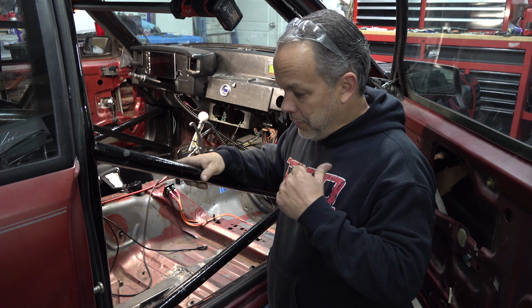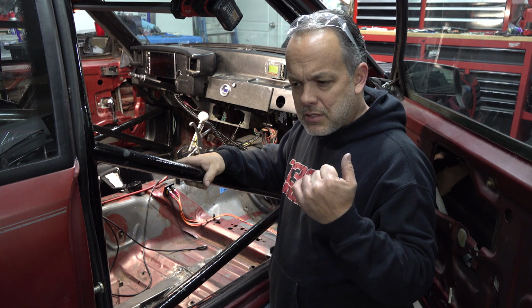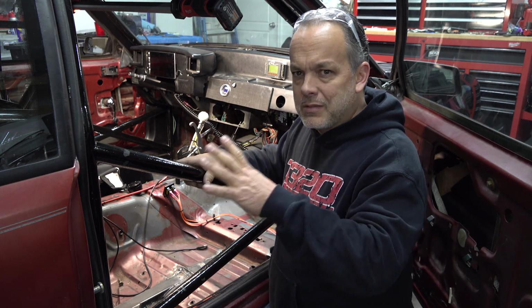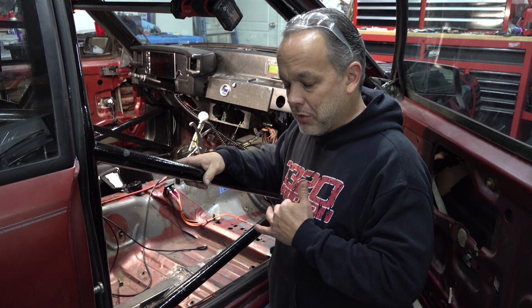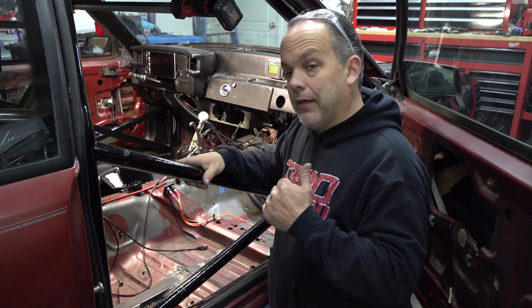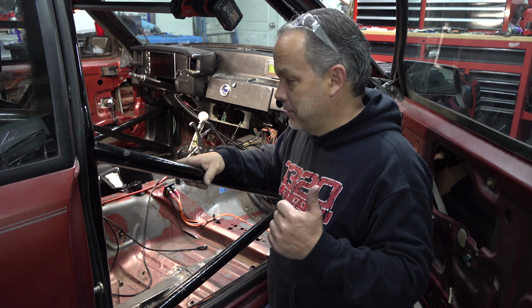And neither one of those things were affected by the panel resetting, apparently. As strange as it is, and I just cannot believe it. It could have been a problem at some point down the road, but on this day, it wasn't the problem. So like I said earlier, I turned on the noise filtering, and the car goes down the track 5 times in a row, sets a new best, runs better than I expected it to. So we're going to call the noise filtering a fix.